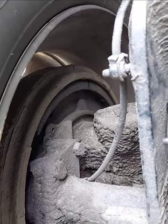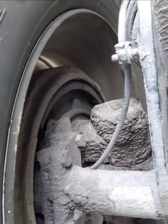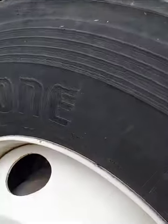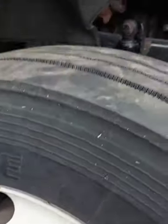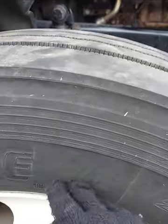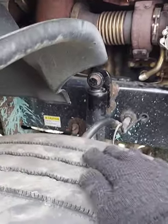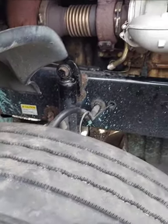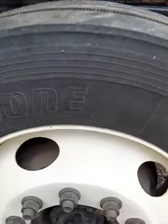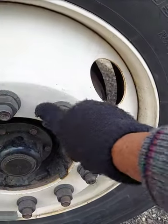I got my brake drum inside — secure, no crack or illegal wear. My brake shoes, lining at least one quarter inch thick, no debris. My wheel, in and outside of my wheel, secure, no crack or illegal wear. My tire — the sidewall of my tire — secure, no crack, dry rot or bulges. The top of my tire, even wear, 4/32 tread depth. It cannot be recapped. My lug nut, secure, no missing, no sign of being loose, indicated by bleeding rust or shiny metal.